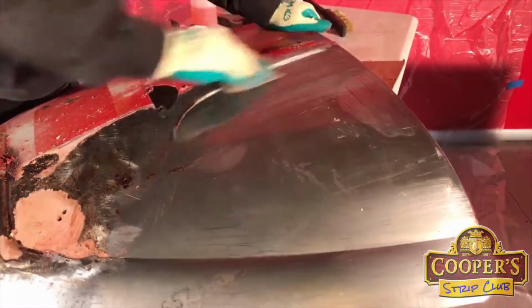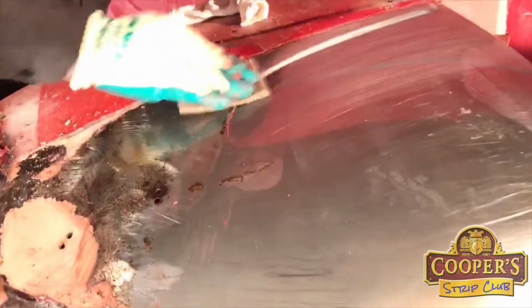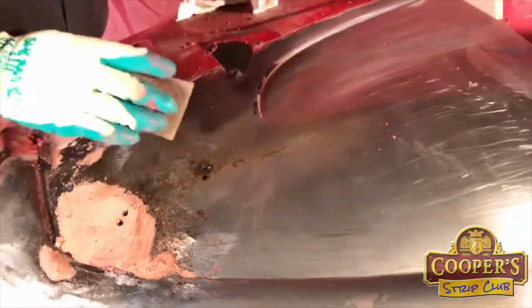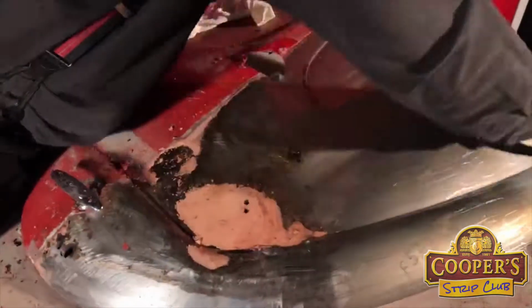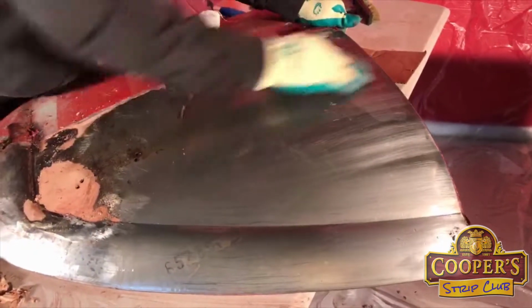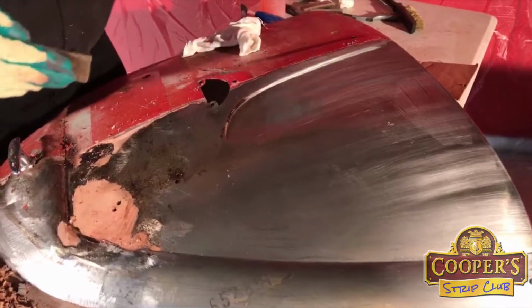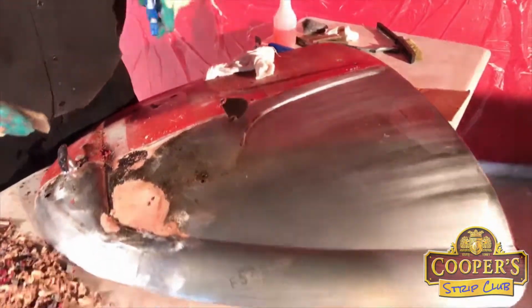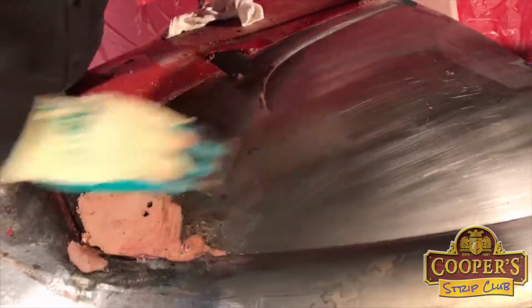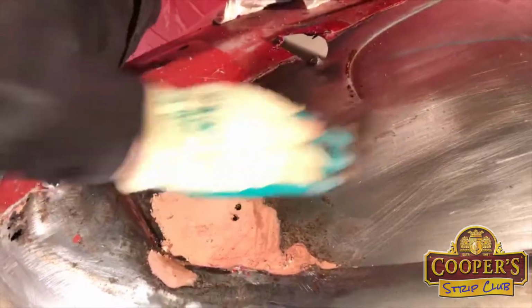So any easy to remove surface corrosion, we'll just come away with this. You'll see there's a bit of that rust residue-y stuff there, and so you can put a bit more time. Sometimes people ask us, can we use thinners or meths or something? We like something that is slower drying and not as stinky. This paraffin-based spirit stays wetter longer, so there's more work time. So you're going to use less, and it doesn't stink. It smells a little bit like candles.